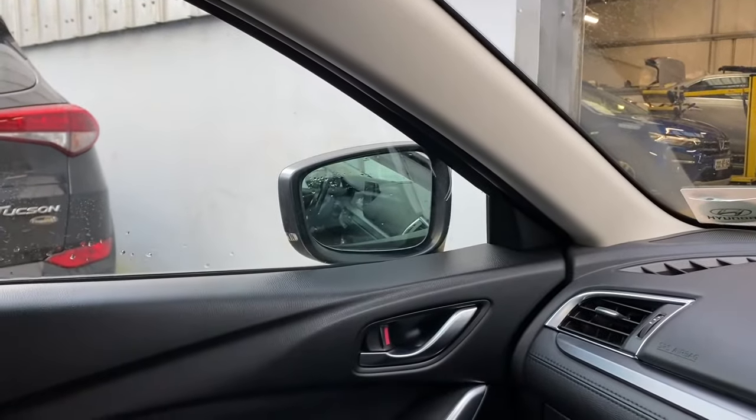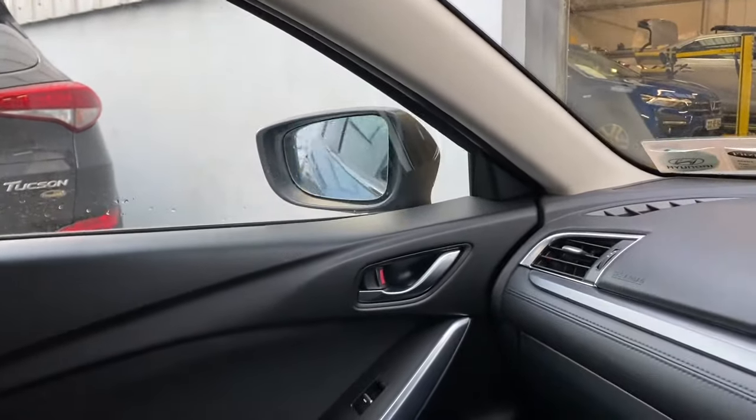This new one is working perfectly, and this one over here is also working perfectly — and all we did with that one was literally just grease it up. I'm not saying it'll definitely sort your problem, but in our case instead of ordering a new door mirror we probably would have been better off just greasing the driver's one first. So it might save somebody some cost and expense. If you have a door mirror issue on a Mazda 6 — this one's a 2017 — this might save you some money, and it's definitely worth trying before you order a brand new door mirror. Thanks for watching.